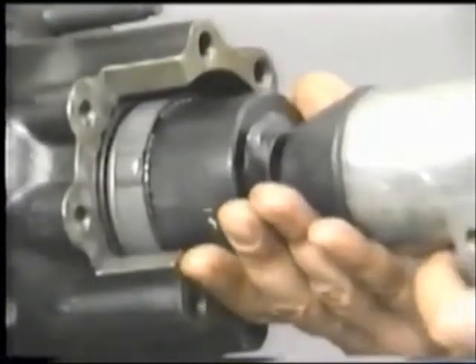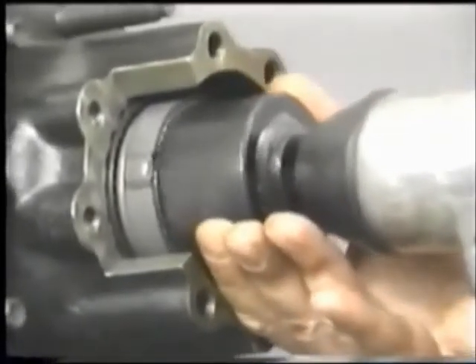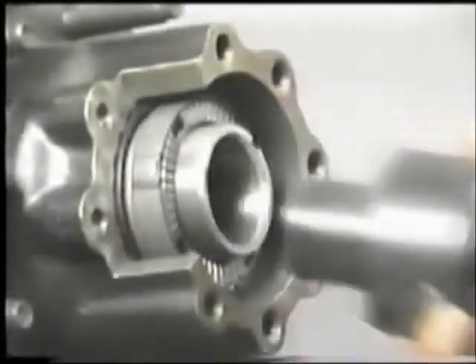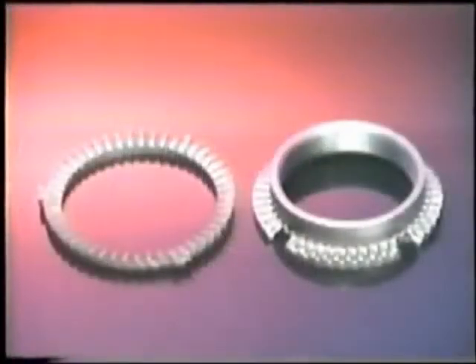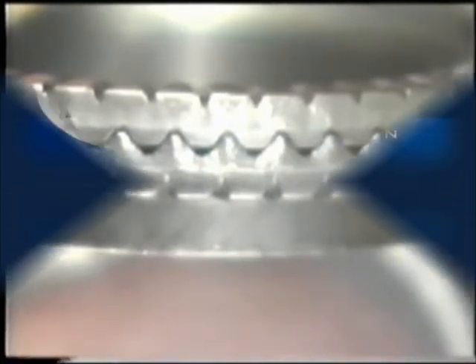The only way to rotate the nut is to disengage the lock ring by applying axial pressure with the spanner wrench. The WN series wheel bearing retainer nut is easy to install and easy to remove when the vehicle requires service, but unless the teeth are disengaged using the spanner wrench, the nut will remain securely in place. In addition to providing a secure mechanical lock, the large number of teeth on the lock ring and nut also makes possible a more controlled end-play adjustment, because there are more potential seating positions around the circumference, allowing the wheel nut to be positioned more precisely on the spindle.